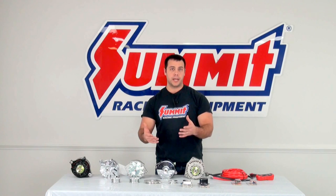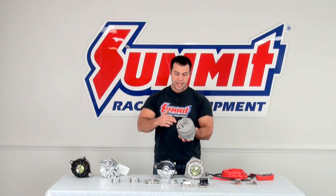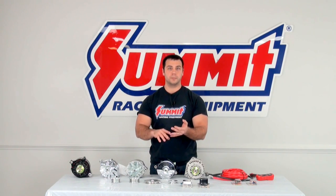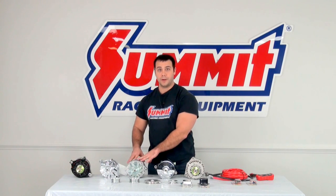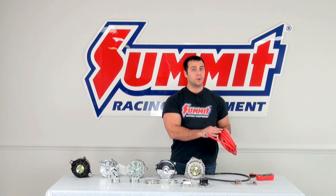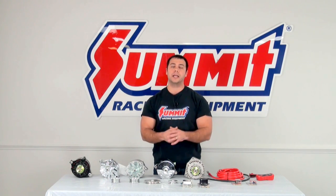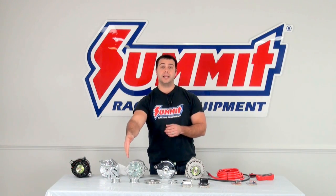Wrapping up this video, make sure you're choosing the right alternator for your application. A few tech tips: if the B-post or B-terminal on your alternator is going to come in contact with a valve cover, bracket, or something like that, give us a call and we'll walk you through clocking your case for appropriate clearances. Also, if you're upgrading your alternator in a classic vehicle or street rod, you'll want to upgrade your wires — an undersized wire can lead to issues like a potential fire. Check out my wire sizing video; I'll leave a link in the description below.